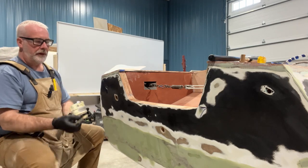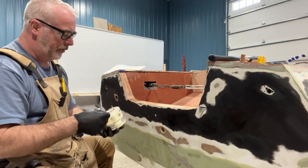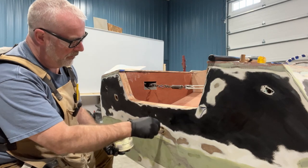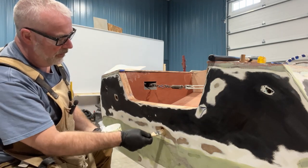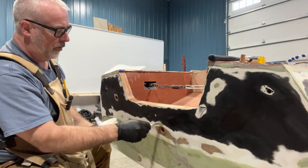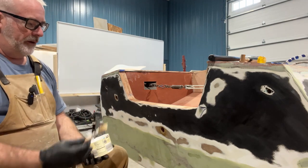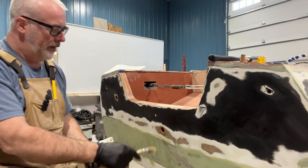This will also happen down here at the through-hole fittings at the drains — these have all been cleaned out with acetone. This will be the drain that is always open, where the motor well is, and it will allow me to put a nice chrome or brass drain plug in there — though it'll just be a drain, always open, so I really want that one to be sealed. There's another one down here when I get done fairing that I will re-bore. That's what they call the bilge drain, at the very bottom of the boat, which allows the bilge to drain under the floor. That will have a permanent plug but get the same treatment.